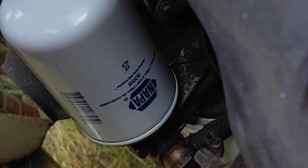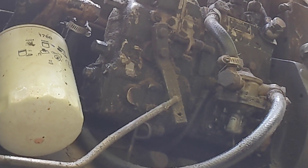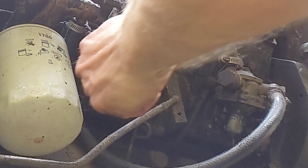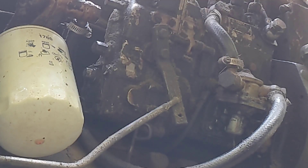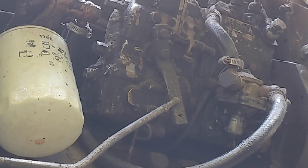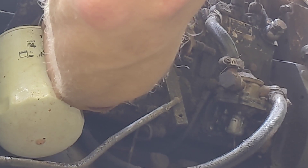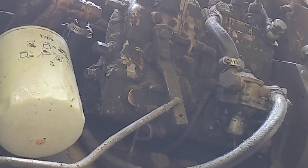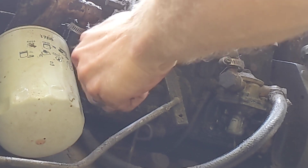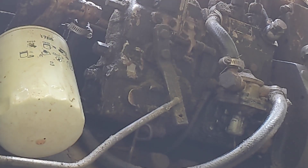Now let's get the fuel petcock open back up. Fuel tap is opened. Let's go to the next steps. You probably don't have to check the governor oil bleed, but since I'm here I'll check it. Again, this 12-millimeter bolt — I already cleaned all this up before I started filming. It's a threaded bolt with a bleed hole, and I saw some oil come out when I opened it up. I'm going to call that the excess oil bleeding off, so I'm going to call that good. The manual says if nothing comes out, add motor oil to that top hole.